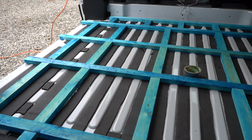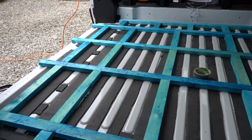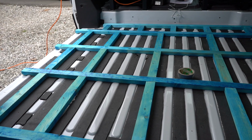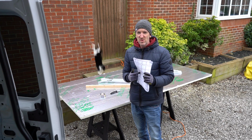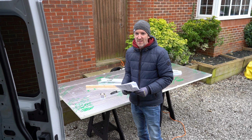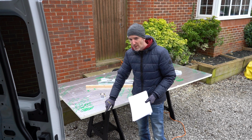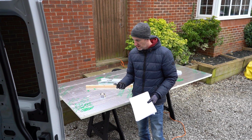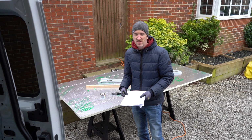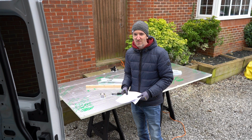So today's job is to make a start on the PIR insulation board. What we're going to do is cut that to each of these gaps and then fit that in. I need it to be a fairly snug fit, so I'll do a few first and see how that comes along, and then we'll crack on with that. I've updated my trusty diagram and numbered all the gaps, so if we need to take any of this out, I know exactly where it's going to go back in. The plan is to measure out each of the gaps in between the battens and transfer it to this 25mm Kingspan PIR board. I think the Stanley knife will be fine for cutting through this depth of insulation. So we'll cut it out, fit it in here, and make sure it's a nice snug fit. I'm not expecting any of this to be truly square, so there might be some slight editing of it, but we'll give the first one a go and see how we get on.